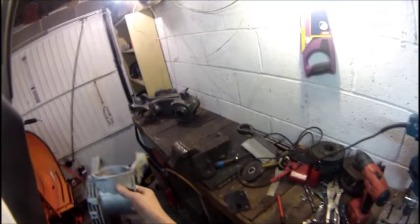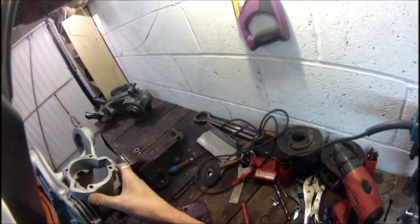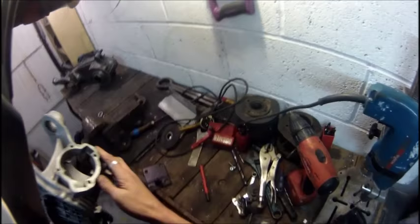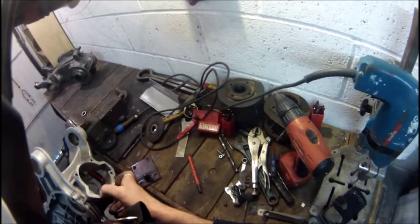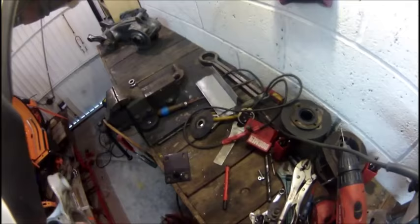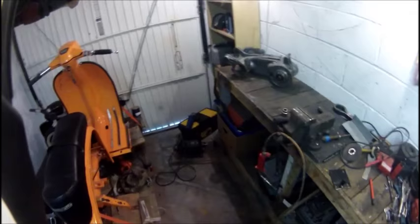It came with a 200cc engine casing which is up there - all in good nick. It's had a little bit of welding on one of the studs, but looking at it, it's quite a decent job. I took it to the local scooter shop down in the village and he said it looks fine - recommended just polishing that up a bit on the inside on the transfer. But I don't really want to take too much off there because that's where all the strength is, and it's already been welded.